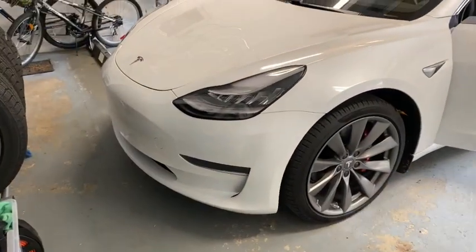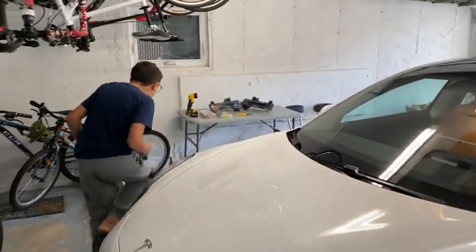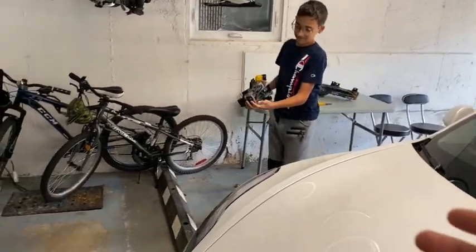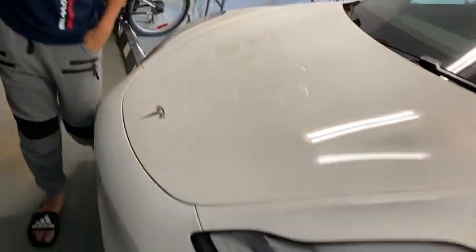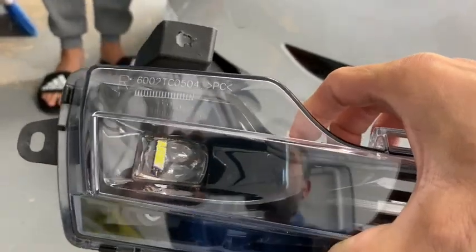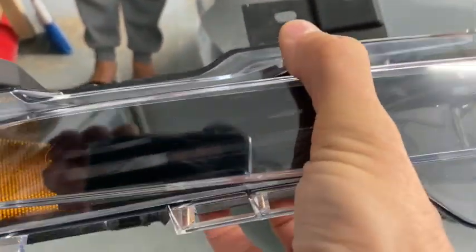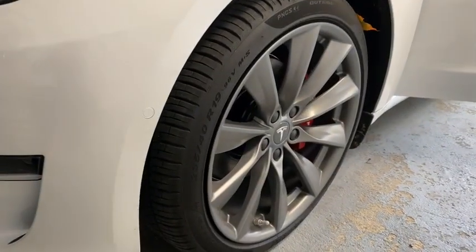Okay, pass it over - so this will be the replacement assembly. You can see there is the LED in there for the fog light, and then there's also the LED strip in there. So we're going to get that done. First step, we have to take off the front wheel because we need access to get to the back of the fog light and unscrew it.